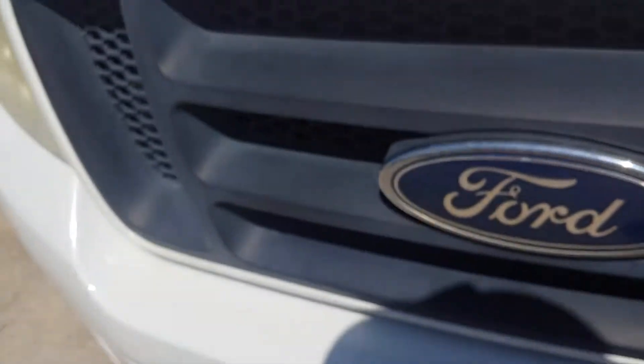The pads are low - probably almost squeaking. Front brakes need to be replaced. That one's really, really close, probably skimming metal.